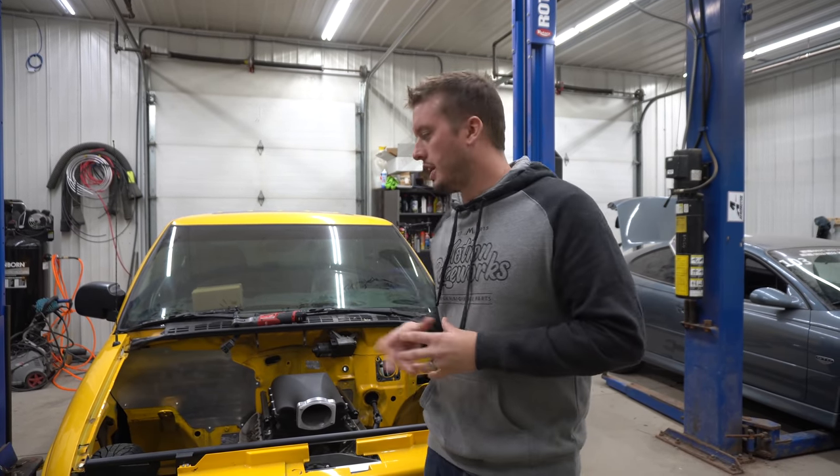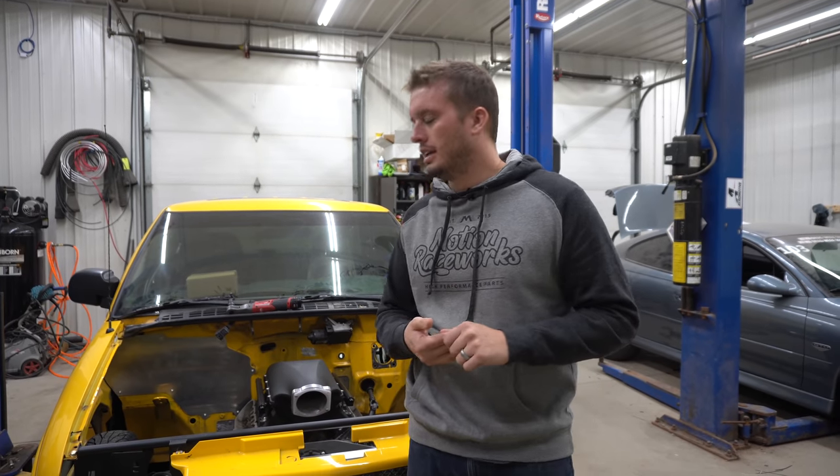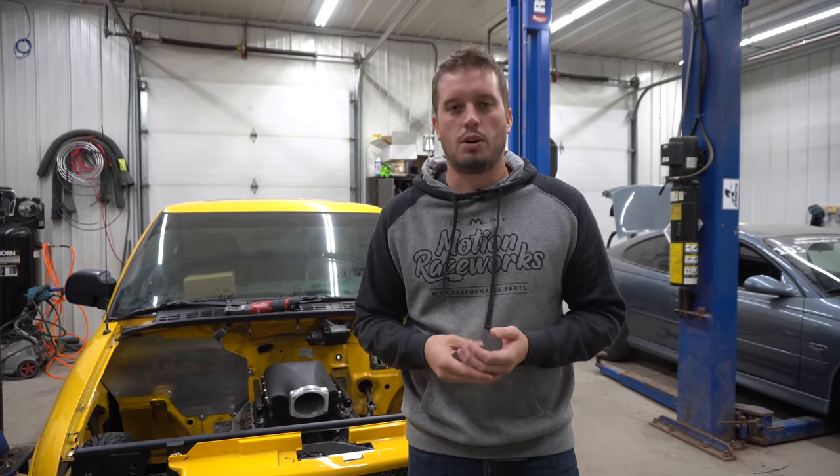This is a really cool kit because it allows you to get rid of that big bulky master cylinder and brake booster, which on an LS and a lot of other V8 platforms will actually hang over and cause issues with valve covers and just clearance issues in general. Also, if you're putting race brakes on, you'll want the manual master cylinder a lot of times because depending on how the engine is built, you might not have enough vacuum to power the brakes with a booster master combo.